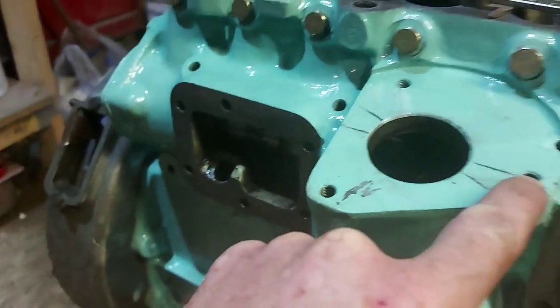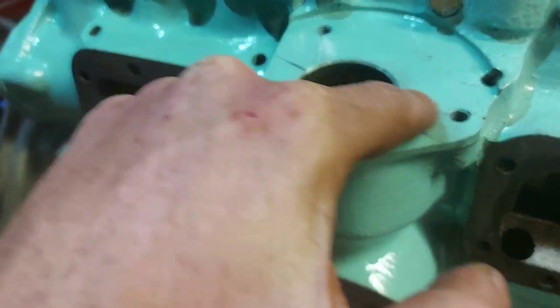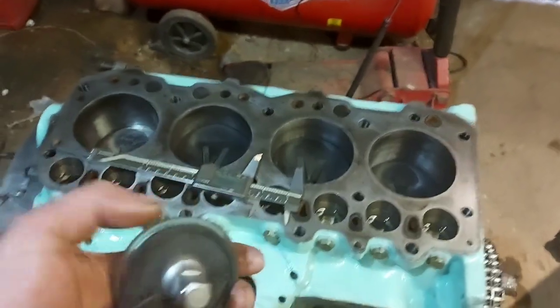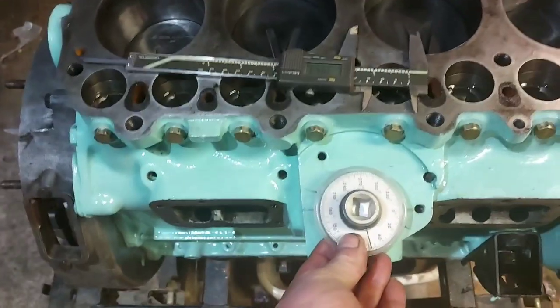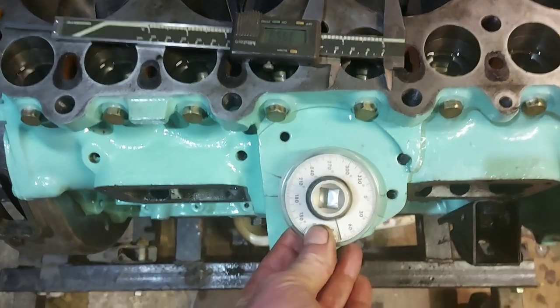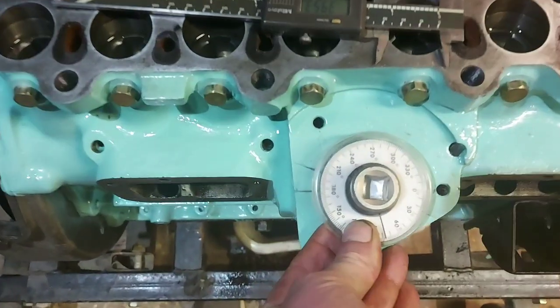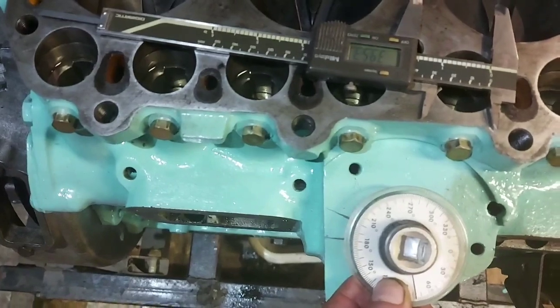So what you've got, I'll go over it again, is the exact centre of that bolt hole, the exact centre of them two bolt holes, that gives you that horizontal line across there. And then you need to measure 20 degrees off there, which is where this comes in handy. What I do with this is you line up your 0 and your 180 on the horizontal mark, and then if I can line this up perfectly, you need to mark off, it looks out of line on the camera but it's not, your 20 degrees and 200 degrees.